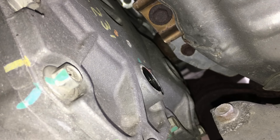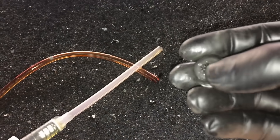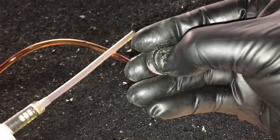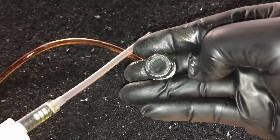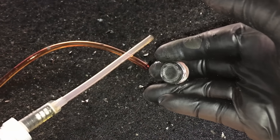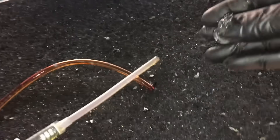When it spills out just a little bit, that means it's full. You can already see this fluid is just blacker than black and it smells really bad. Look at that — that thing is freaking caked. At this point, it's not even collecting metal filings because it's so caked and covered. This is why you want to be changing this out. The fluid breaks down and stops doing its job protecting the bearings and gears — blacker than black, like tar.